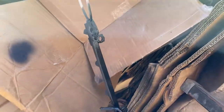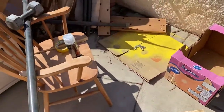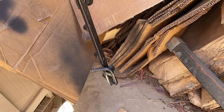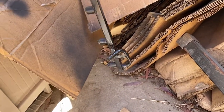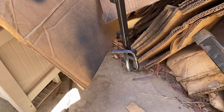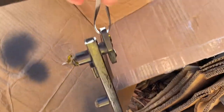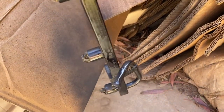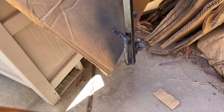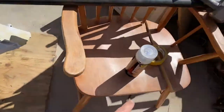First coat on the fuel rail — let that dry and then on to the next. We just got the last coat on, it's looking pretty good with pretty full coverage. Now we're gonna do some clear coat. I got a little bit of clear on this as well just to see how it works because the paint I used for the fuel rail was Rustoleum, not VHT, and I'm not sure if it's taking to the clear coat that well. There's obviously a run right there and some little spots that look a little weird, but we'll shoot it a couple more times and see if it shines up.